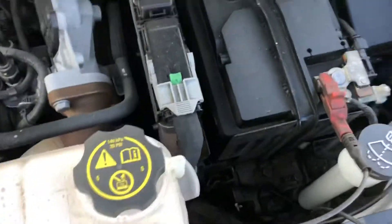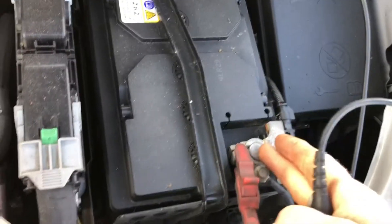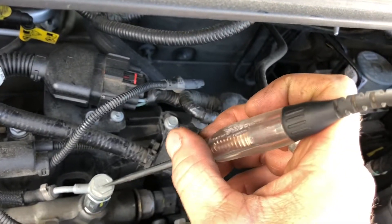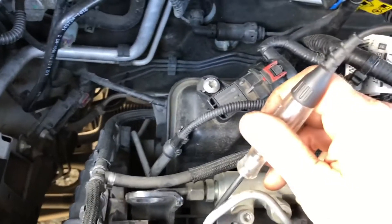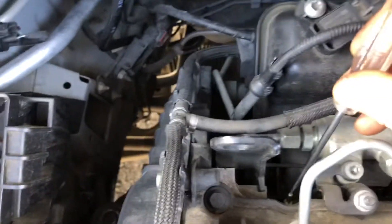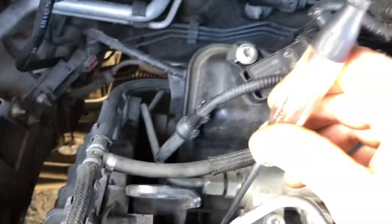What I'm going to use — one of my followers actually suggested it — is a test light. So I'm going from battery positive over and on to the fuel rail just to make sure the light is working. Now back on to number one glow plug — you can see when I get on to number one glow plug, the test light lights very well. It's on the tip of the glow plug at this point in time.